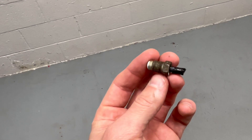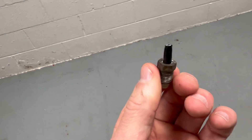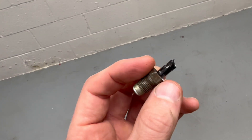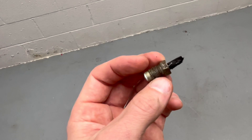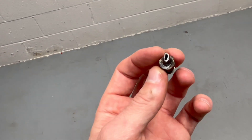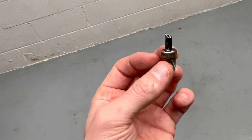As you can see, the end of this is just seized and corroded. When it gets to this point, just cut it off — use the tin snips from the earlier part of the video. That way you're not twisting that hard line under the subframe going all over. Cut it off, get it out, get it replaced.